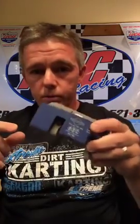I believe it's red. That's a 7,100 RPM coil that comes on the World Formula style engines and for spec racing. And then of course they got the green coil that comes on the LO206 engines, which is an even smaller spec engine. The green coil I believe is a 6,100 RPM. And the red coil is 7,100, and of course this one's 12,000, which no four cycle engine is going to operate in the 12,000 range for this coil, but it's there if you need it.